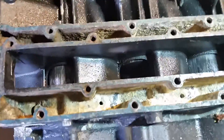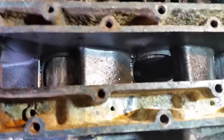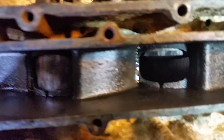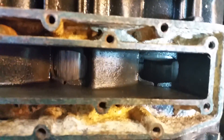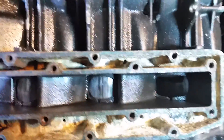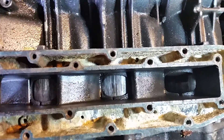Now we can see inside — you can clearly see the pistons, and I am going to move the pistons up and down so you can see the damage. All three pistons are completely destroyed in this unit with no compression. It's very hard to turn it now — that's due to the engine running and the oil metering pump packing in while it was running, which brought total seizure to the engine.